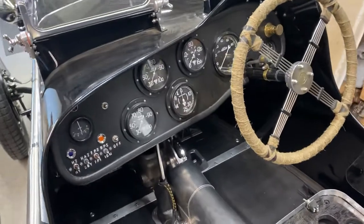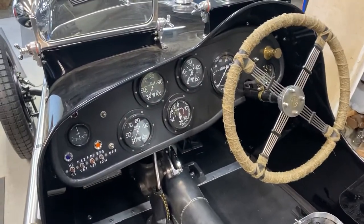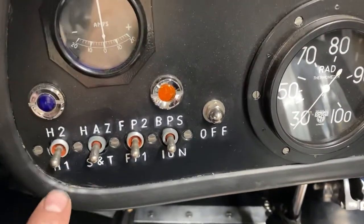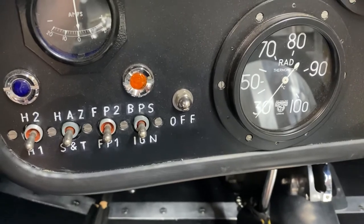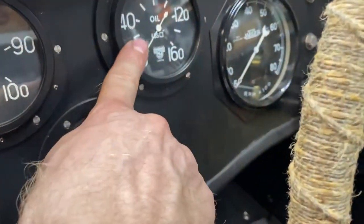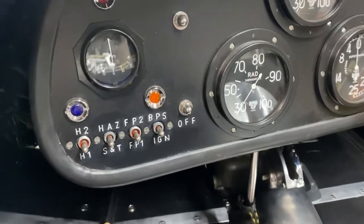Here's the cockpit. The seats aren't quite done — Katie's working on a prototype right now that we can test out using a different kind of leather that's scrap material, so we don't dig into the good stuff in case we make a mistake. We've got the gauges here: low beam, high beam, side and tail light, hazard lights, fuel pump one and two, ignition, and bypass. That bypass is a low oil pressure switch — so if for some reason the switch fails and shuts off the ignition, we can verify that the oil pressure is still high. If it's adequate, it means the pressure sensor switch failed and you can put it on bypass to get the car off the road for troubleshooting.